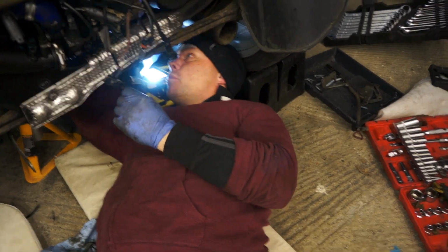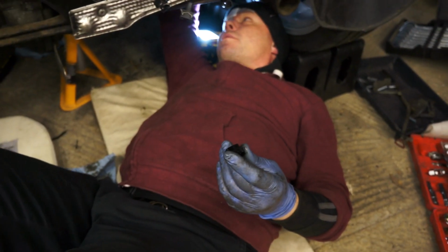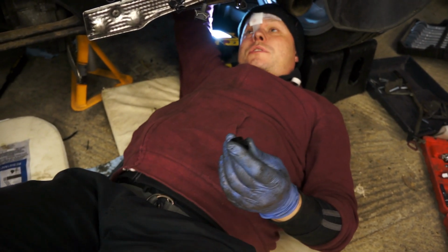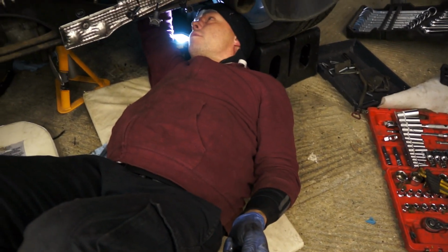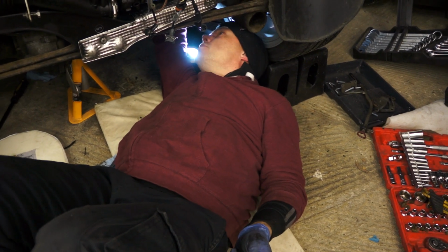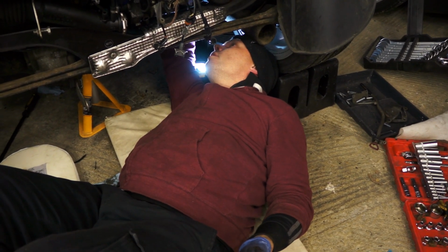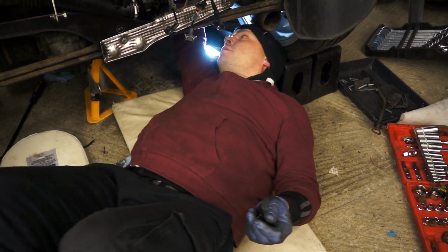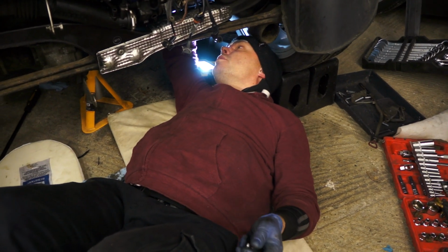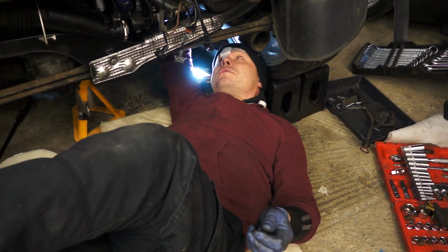Basically, welcome to what's left of your guides. This one was jammed at the bottom, which is off the oil pump, and this one, which is also broken. Oh, there's another piece which has just fallen out, which is broken. And the other piece, come on. Why is the broken piece not wanting to come out? Oh, here we go. Can I get a camera in there? Maybe it's because it's the long piece. Basically, all the slippers are broken. So this was going to fail very, very quickly.